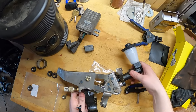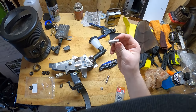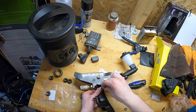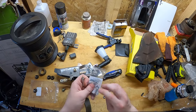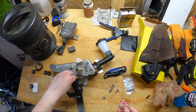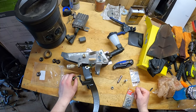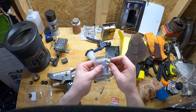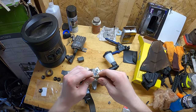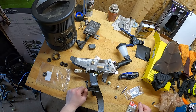You just put it all the way through. This piece is supposed to have a pin that goes through it - it's the same size as the one on the brake pedal, which I thought would work, but I need a smaller pin and then just throw a cotter pin in it. You can use a small enough bolt and nut to hold it down, but I want something factory I can just pop in and out. It's a lot easier to undo a cotter pin than getting in there with a ratchet and socket. I'm gonna run to the store and be back with a new pin.